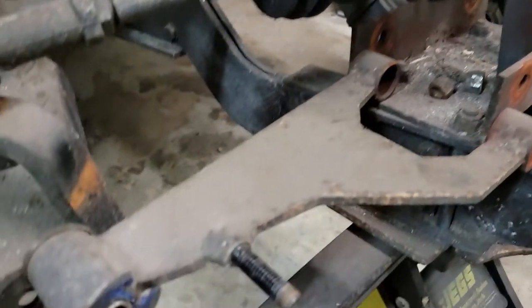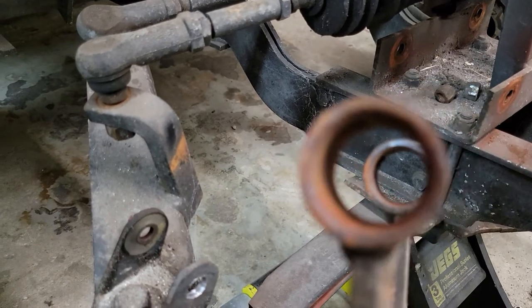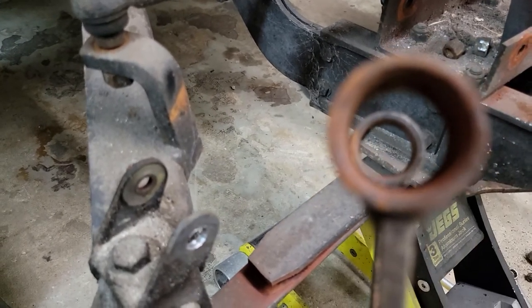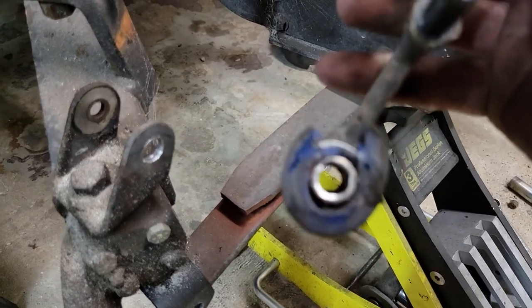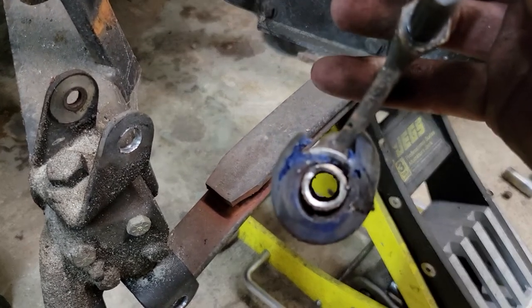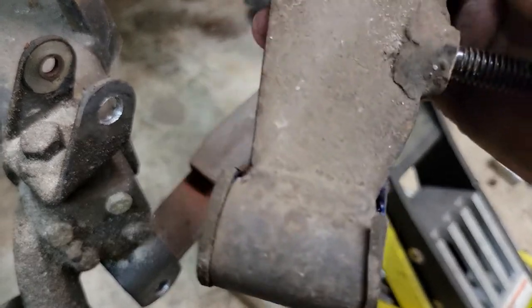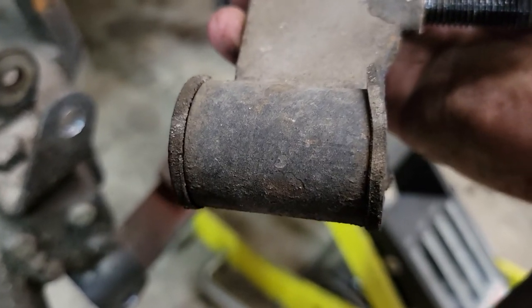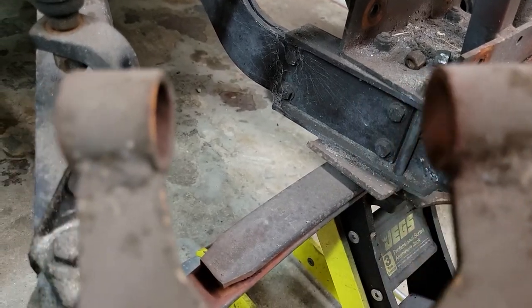We got all the hardware out, and here's what's left of the inner bushings — absolutely nothing. It's all gone. The metal inner core was in there, but that's garbage. Your nuts and bolts that come off of this are all garbage, just throw them away. You can see this was well on its way out. Very dangerous to drive this car — it's a pretty fast car and it's kind of double-lifted, and it does have front-wheel brakes. That front-wheel brake grabs pretty good and it took me by surprise. What we're going to do is press in the new bushings, and then we're going to pilot drill for our quarter-twenty-eight threads, tap into it so we can grease them later and make them last longer.